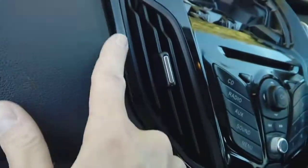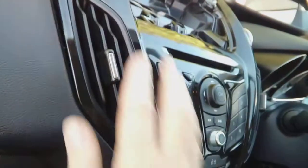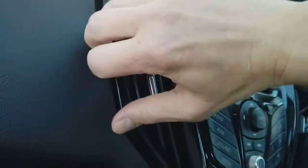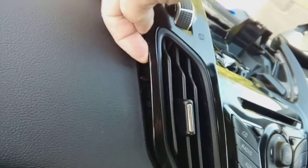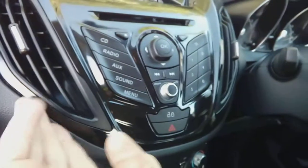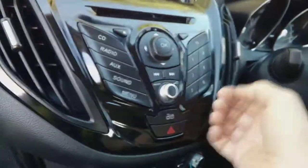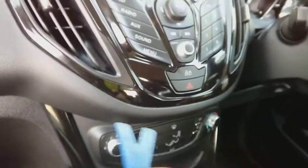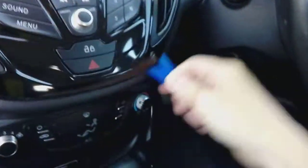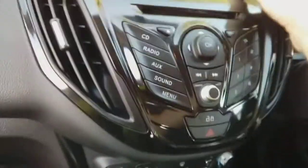Just watch your vents — don't let them fall to pieces. You don't want this detaching; you need the vent to come with the fascia. If the front of the vent comes off, all the little slots fall out and it takes ages to rebuild them. Try and keep it intact because it's really quite feeble on the edge there. You're now left with spring clips at the bottom. You might be able to just get your fingers under and tug it evenly, but if it's tight and it's never been in pieces before, ease it with your leverage tool — there we go, all the way around.